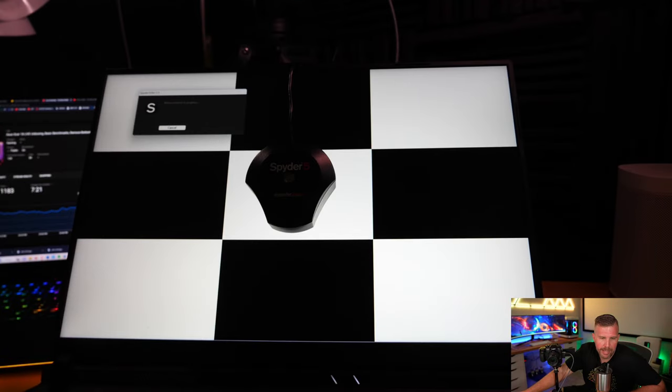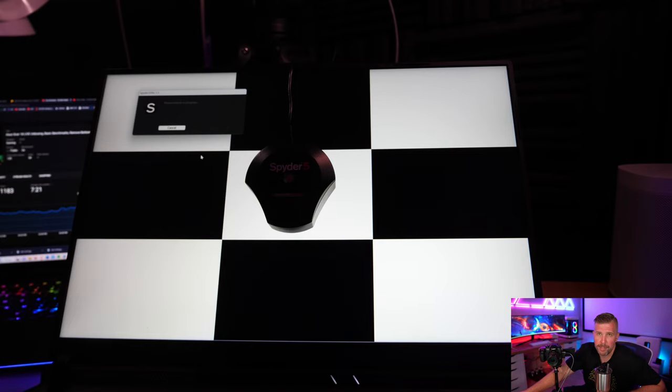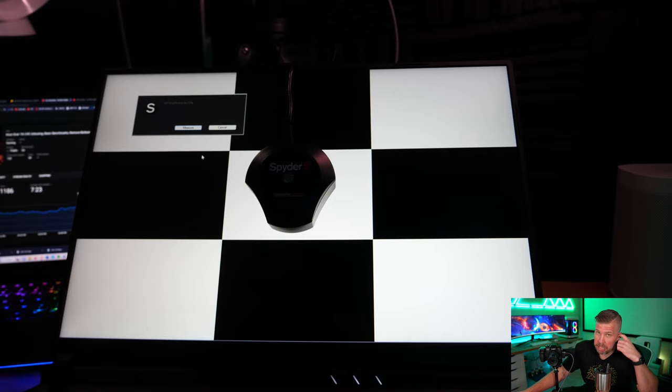I have my Blade 18 at a 0.235 undervolt. That's insane. Are you sure it's stable? Try rendering a 4K file in Adobe Premiere and see if it stays alive. That's a high undervolt. You might be able to get high scores with that in Cinebench, but when you actually do AV workloads, you're probably going to end up crashing the laptop. Maybe. Maybe not. Maybe the new 13th gen Intel have tons of undervolt potential.